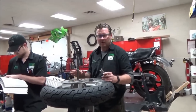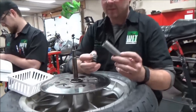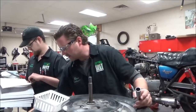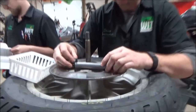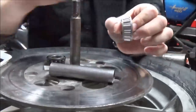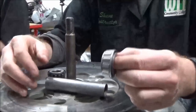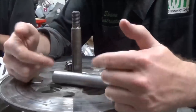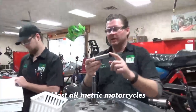We already have a video on how to set end play on Harley Davidson tapered Timken wheel bearings, but we don't have one showing it done wrong. We've got new races in here, and we're going to set this in place. Anytime you put new bearings in, you're trying to set the length of the spacer — adjusting how these rollers sit on the race inside. On Harley Davidsons you have a steel spacer, and on sport bikes it's common to have an aluminum one.